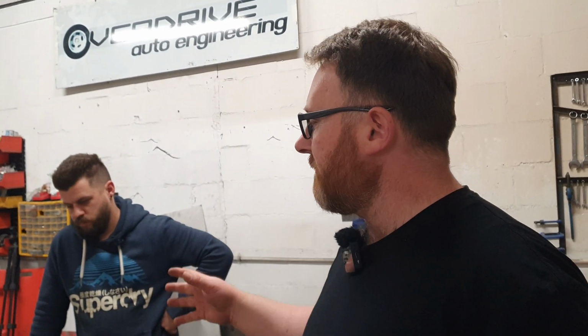So the logic with this took us bloody ages, by the way, was, is there a problem with the ME221? It was just, given strange voltage reasons, it would never put a voltage out when you turned it on. So we thought, let's put the old ECU back in and just see what's happening, because now we've got spark, we may have solved the immobiliser issue. Well, we did. So we wired the immobiliser back in, fixed all the live stuff, and it does deimmobilise and give spark. Which is really, really annoying, because I've just bought an ME221 for...